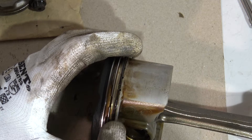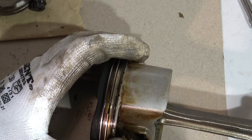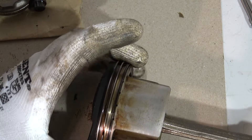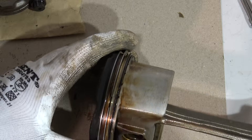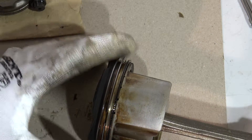There is a little bit of corrosion here, but these piston rings are not stuck. That means piston number four — all of its piston rings are in quite good shape and are okay. Now I take the next piston.